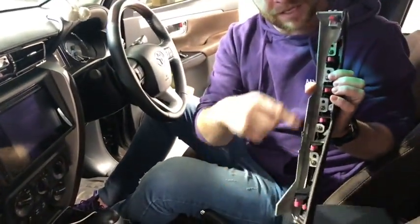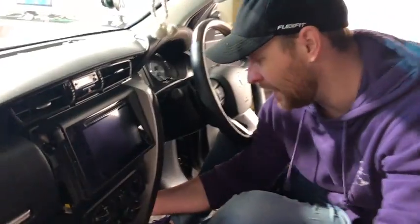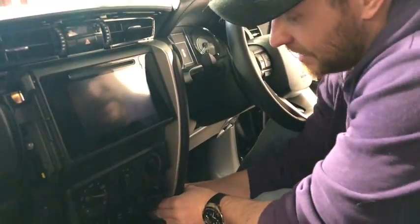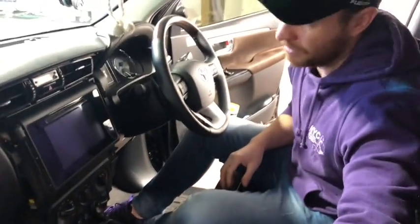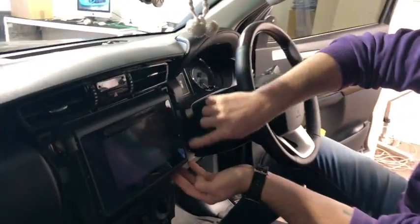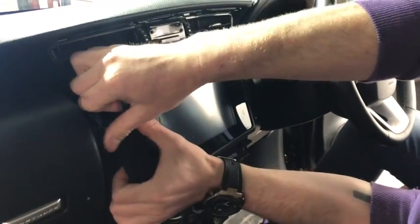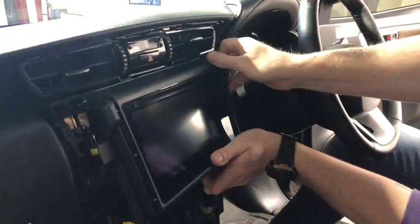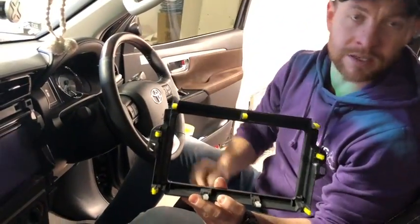There's a lot of clips on these so they can be a little bit tight — just be aware of that. Just put your hand behind, cradle it at the front so you're not going to snap anything or scratch anything, and she'll come out very, very easily. From there, you're going to remove the shroud around the actual tablet-style stereo — that simply clips off as well. Just put your hands behind it and she'll clip off; it's just got a couple of locking clips.